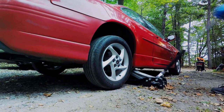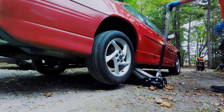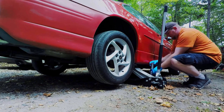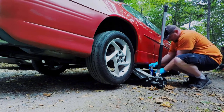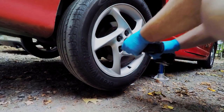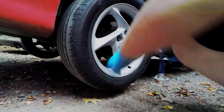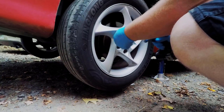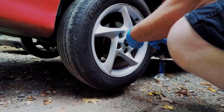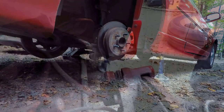The first part of this is, as always, to lift and support the vehicle on jack stands. Once you have it up in the air, just remove the wheels. Then remove the rear brake caliper brackets — take the entire caliper, bracket, and pads assembly. Do not disconnect the hose yet; I always wait to do that till last. Just lay it out of the way, and then the rotor should slip right off.